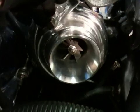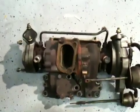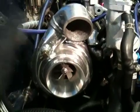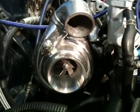Why did I pick this guy? This little video is on picking a single turbo and some of the basic science behind that. My particular video will have experience between the GT35R and those bastards, the stock twins — which, disclaimer, those aren't actually stock twins. Those are shitty JDM knockoff versions that only work with the JDM manifold, which if you bought on eBay to replace your stock twins, they're not going to work. Nice little piece of advice there. This is a ball bearing single turbo — much prettier, obviously shines better. But why did I buy it? I bought it because it's going to flow more air, meaning more horsepower, for my stock '93 Mazda RX-7. Pretty cool.